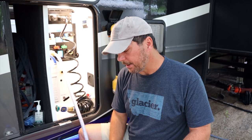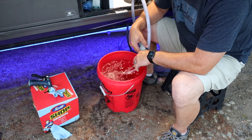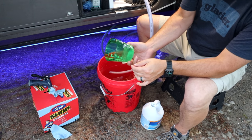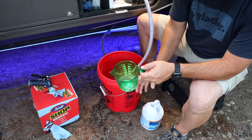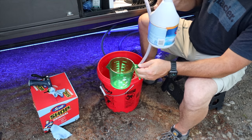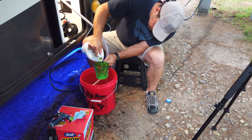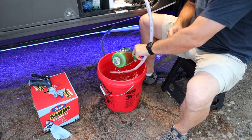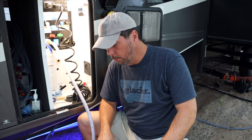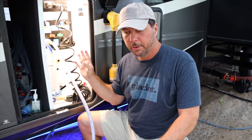For the siphoning into the lines section, it's not going to have a larger body of water to mix with. So I want to make sure this mixture is about the same ratio — one cup to 50 gallons. Since I have a five-gallon bucket, that's about a tenth of a cup. It's not really marked on the measuring cup so I'll use just under a quarter cup — it doesn't have to be exact. I'm going to flip the system over to siphon to the lines. One thing I've noticed on this Nautilus system is the labeling is a bit weird — it has 'sanitize, siphon to the pump' and 'winterize, siphon to the lines/fixtures.' The description is accurate; it's just the winterize versus sanitize labeling. You're going to do both really, and that's what we're doing.